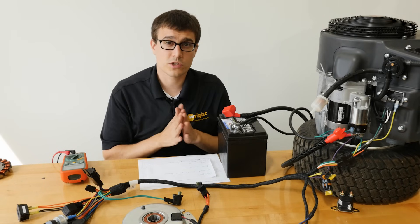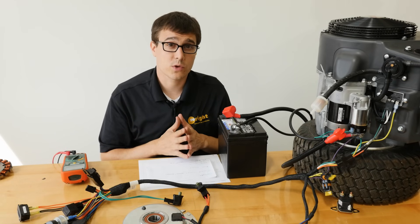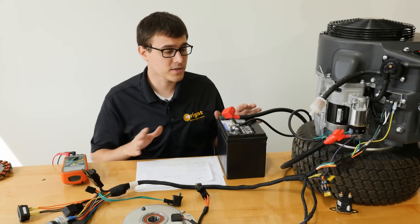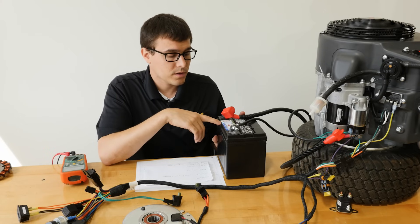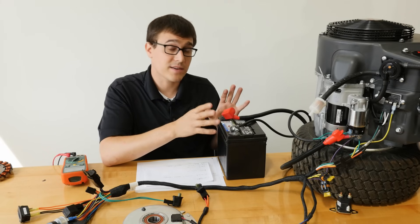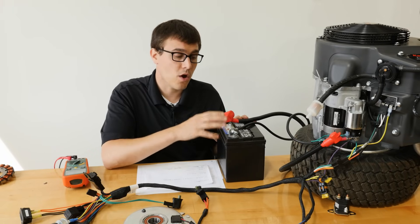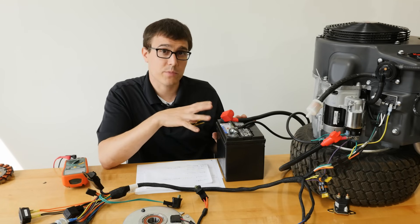There are a few ground rules to be aware of, because when you're doing diagnostics and you're not familiar with what's going on it's very easy to forget something. Now let's go through the major components of the system. Here we have the battery — this is a 375 cranking amp or 300 cold cranking amp battery. Some big box stores sell batteries that look like this but are lower amperage rated for smaller engines. Be sure to get a battery that's capable of your machine.